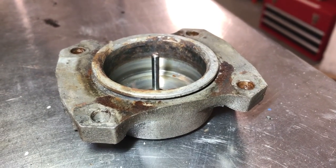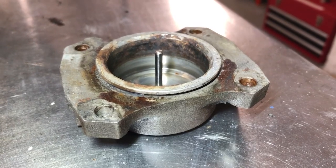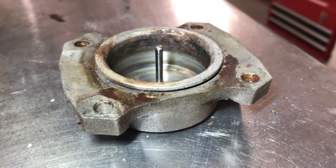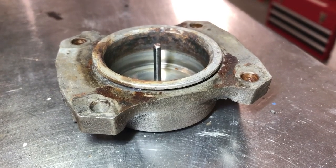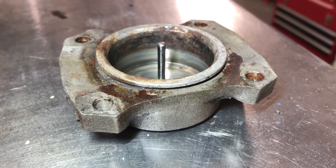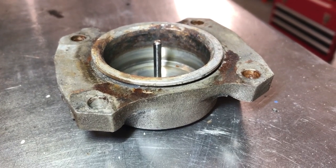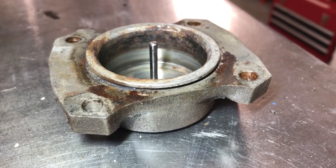With the piston carrier clean and dry, we can now see that there's corrosion halfway up the bore — these obviously need replacing. It might be possible to salvage them but there's really no point. There are plenty of much better modern alternatives to the same exterior size that are just a bolt-on replacement with better seals and will function more reliably and consistently. So that's what's going to have to happen here.